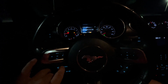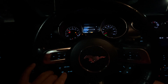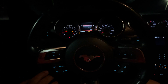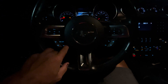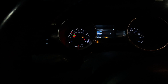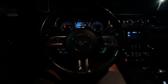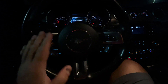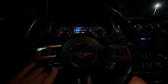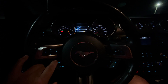For the sake of testing, I'm going to do resume minus, bring it way down so I don't over-rev the car - let's say 2,000. Resume, we're going to hit control off, floor it, so I'm to the floor - about 2,100 or so - I'm to the floor, and once I let go of the button, it should fly past that. The reason I did it is I don't want to hit the rev limiter, so we're going to hit resume minus, bring it up to 4,000 RPMs, resume.